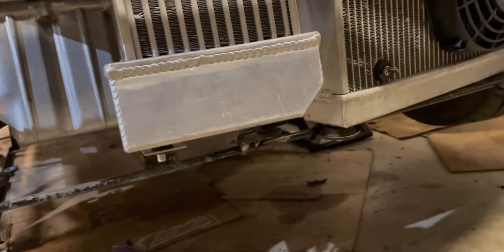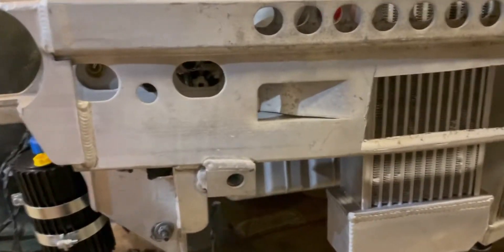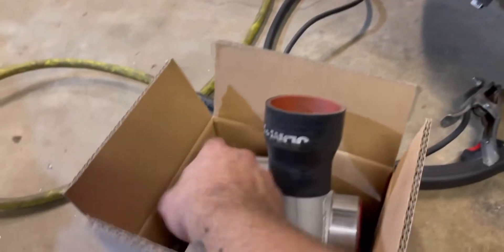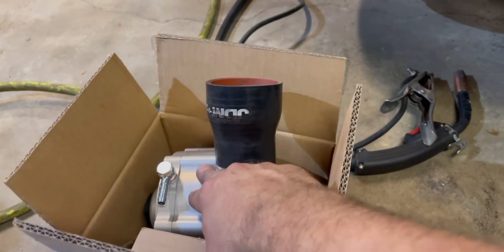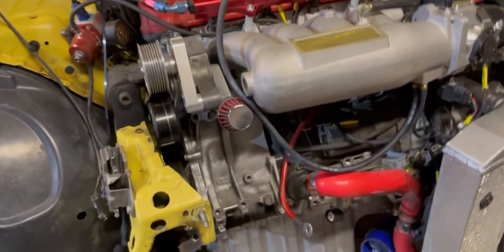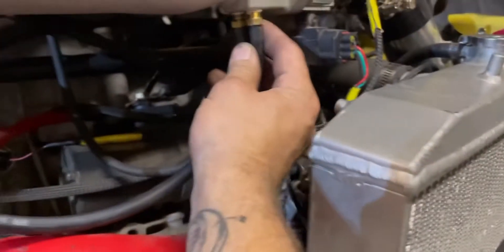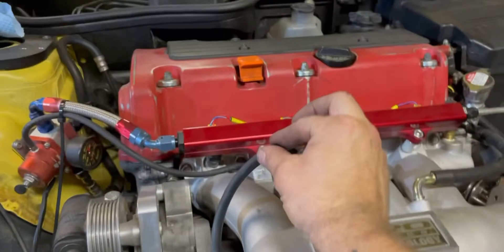Okay, I spotted that back on. After I cut it off I realized I can't really go in any farther because of where the pipe is welded, so it's probably pretty close to where it was. I'll fully weld that in a second. Right now I put this back on to mock up the oil cooler, because I need to figure out how long the oil cooler lines need to be to run them to the supercharger. Once I know that, I can permanently mount the supercharger and not have to pull it off again. Also threw some paint on some stuff while waiting for things to dry, and put two vacuum fittings in — one ran to the fuel pressure regulator and one going to the blow-off valve.